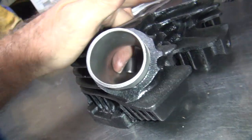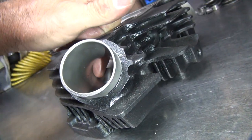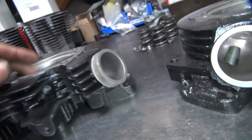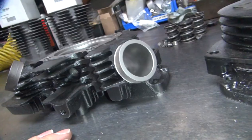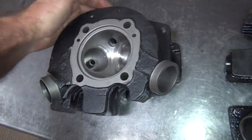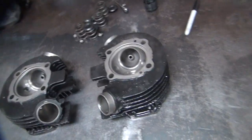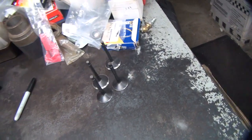The exhaust is kind of the same way — see how it's constipated through here and wide open through here? You don't need to make that any bigger, it's already too big. It wouldn't hurt to open the other side up over here and let some air out. People have their theories about how these things are supposed to be. These are not the best quality heads, but they've had a lot of work done on them. They also got four spark plugs put in there in case you need an extra set with you — debatable if that's any better. I didn't see any pinging on my race bike. Anyway, I'm going to do a little basic redo on these. We're going to see how much work gets done tonight. Let me get the valves ready to go and do a little honing.